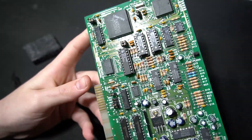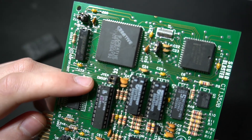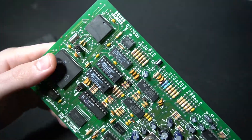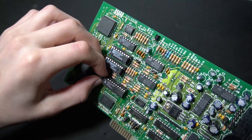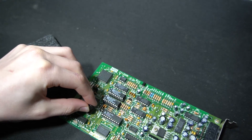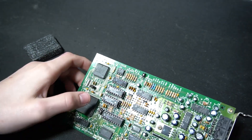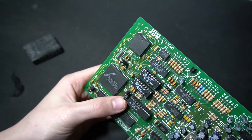There's one last thing we need to do. As you can see on the card there's a little jumper which says CMS off. That comes jumped from the factory because Creative didn't include the CMS upgrade, so they had it off. Since we've installed our CMS upgrade, we can lift this jumper off and place it to the side. If we ever decide to uninstall the CMS upgrade we'll need to change that back, but as long as it's installed we need to have that jumper off.